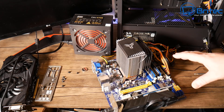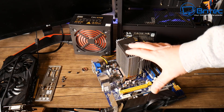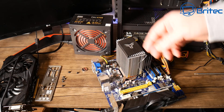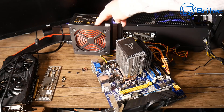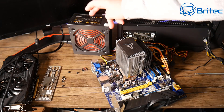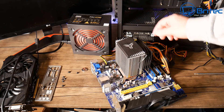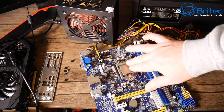For the video, I've removed the motherboard out of the case just in case there was some sort of grounding issue, and you can see I've got it on the bench. I've changed the GPU to the secondary slot and given it power - we're still getting no signal, so it's definitely that motherboard that has failed. A word of caution: don't use cheap power supplies. This one is just what I had to hand - it's not sufficient for quality use as you can see from the cabling, but it's good enough for testing what we've got here.